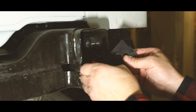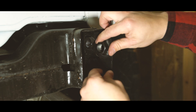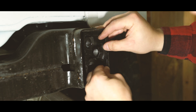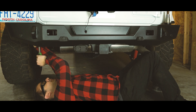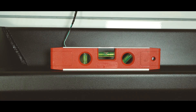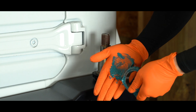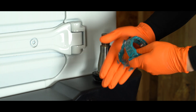To secure the base of the bumper, Expedition One adds a third nut on each side of the frame rail. To make sure this nut stays in place, we recommend using 3M double-sided tape. At this point, you can set the bumper in place and start tightening it up a little bit at a time. It's critical that the rear bumper be level, as being tilted too far forwards or backwards will cause alignment issues between the swing arm and the tailgate plate.